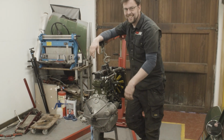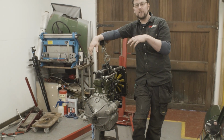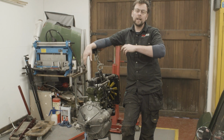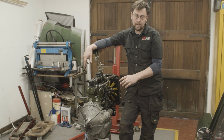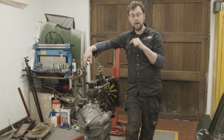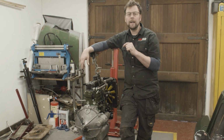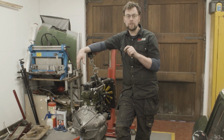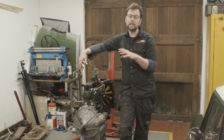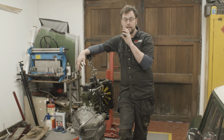In this case, it is taking off the clutch housing. Then we need to release the flywheel from the end of the crankshaft. Then we can take the drop gear housing off. Before we do that, we need to drop the oil out because there is brand new oil in this engine that I want to keep. So I have a lovely, fresh, clean container to drop it into. Drop the oil out, then we can take off the drop gear housing and we can start having a look